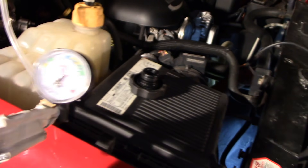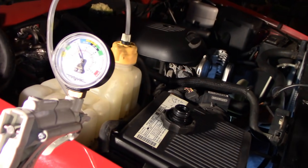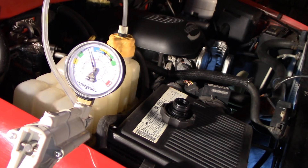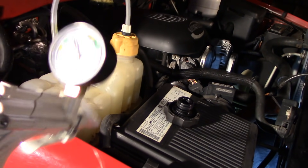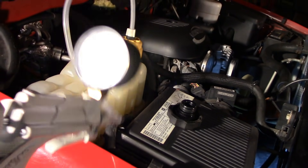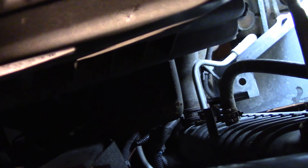Although it doesn't overheat, so that doesn't quite make sense, but we'll see. I pumped it up again and she started leaking again. I got a lot of coolant out of there and it is losing pressure, so it definitely has a leak. I swear it held pressure before. I think it's the bottom of the radiator where the bottom radiator hose goes in. Let me pump this up again and see if I can get it leaking so I can go underneath and identify it. I'm thinking it's the tank itself.